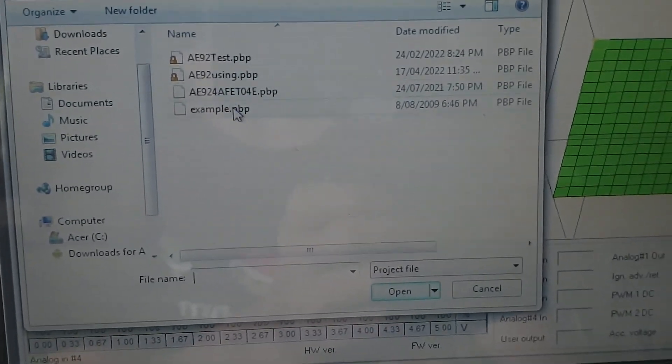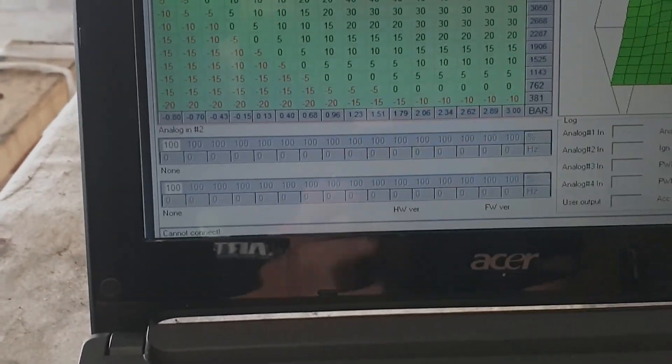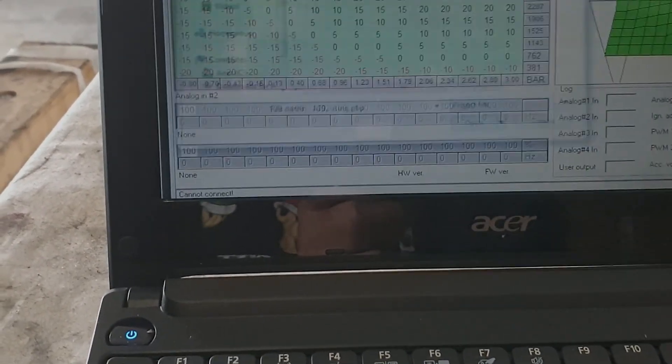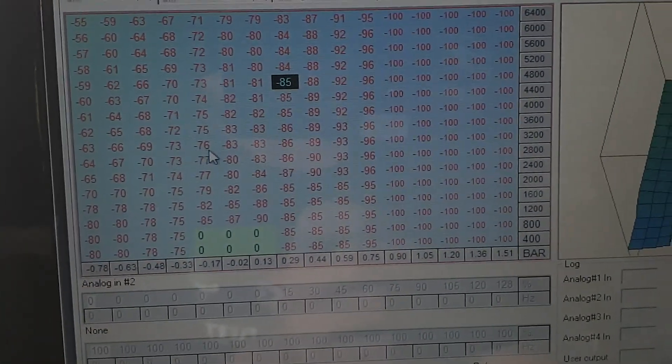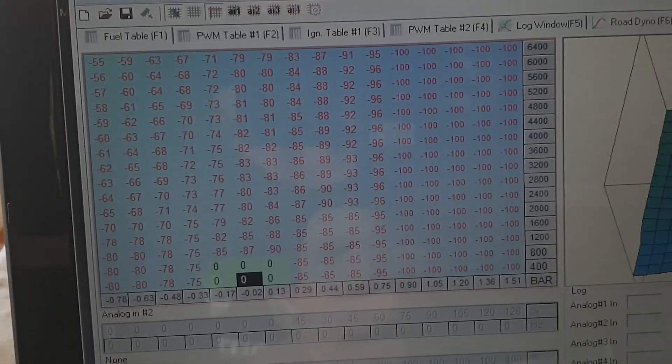It's just not the best equipment for doing the job on the tuning side — it's just about setting it up in the software and making sure you've got everything right and how you want to use it. I'll load a project — this is the ECU Tuner software. I've got my 4AFE. Because I've got bigger injectors, I've had to minus the signal of the MAP sensor to account for fueling. I'll explain that in a minute — it's a little bit confusing, but once you get the gist of it, it's really not that frustrating.